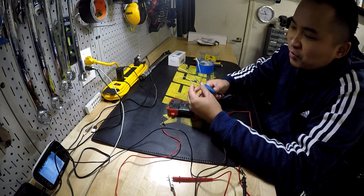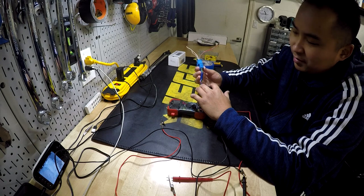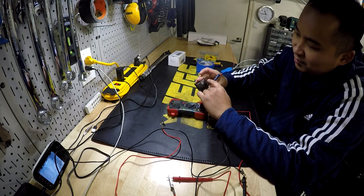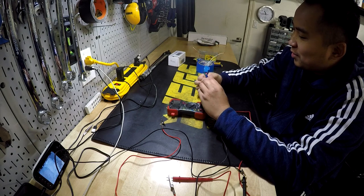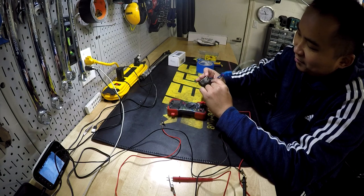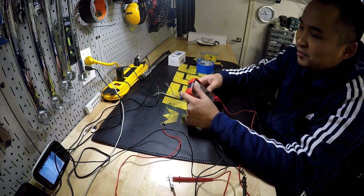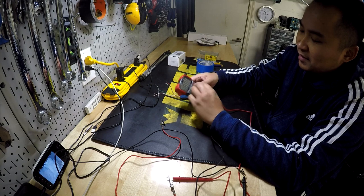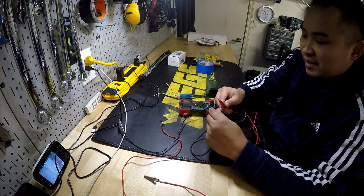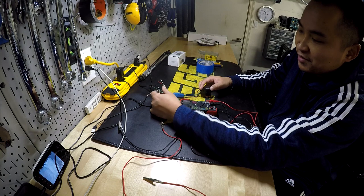What we need to first do is determine which wires we need to use. There are five wires on here; three of them are going to be the ones of interest. The other two are probably the ground and the illumination — this thing probably lights up, there's a bulb in here. To figure this out, grab a multimeter and set it to continuity. When the two probes are connected together, it says they're continuous. On a switch, all it's doing is connecting two wires together when the switch is pressed.